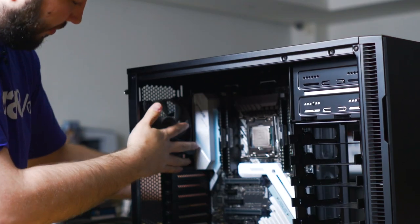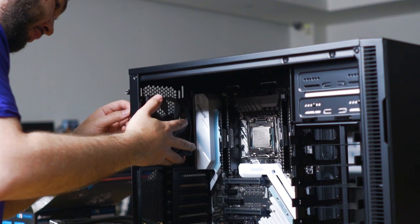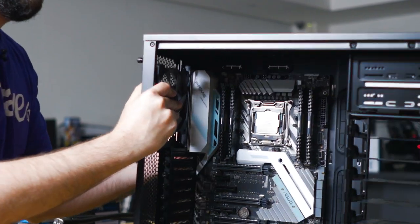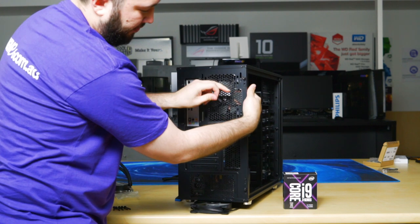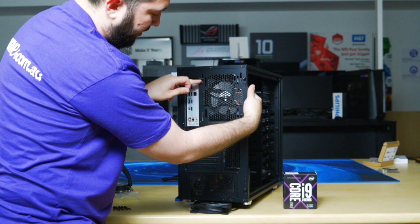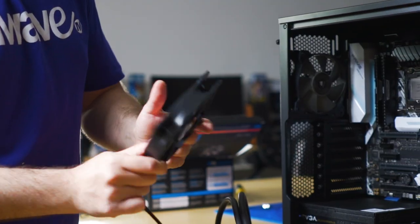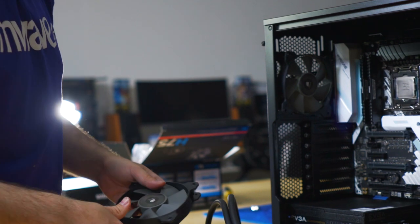You can use that as a guide. You grab one of the screws that you prepared earlier. There are slots at the rear of the case. So you have to line it up with the two inner ones. The outer ones are for larger size fans or radiators. You want the fan frame touching the radiator, so it pushes the air through the rad.